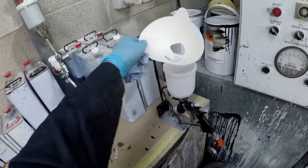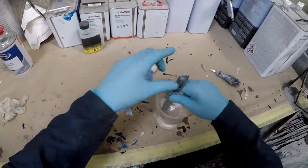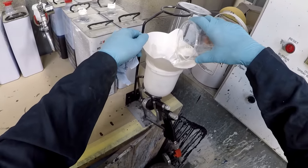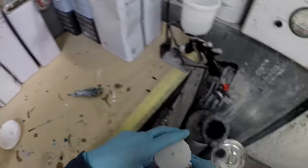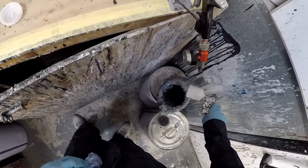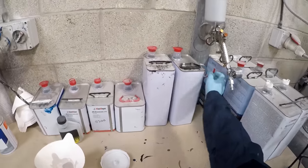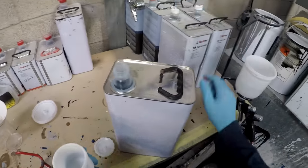The 0200 is still a very good quality clear coat — it breaks nice, polishes up nice, and it's a quick and easy two-to-one mix, clear coat to hardener ratio. I just put in a splash of about five percent thinners to help it flow out. Being a trade job I don't want to spend a lot of time flat polishing — I just want to get this on really smooth and nice with the least amount of dirt in it, so I can give it a quick nib and polish and get it out the door to get the next job in the booth.